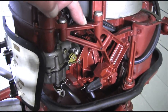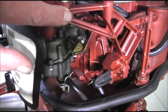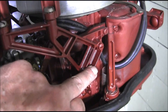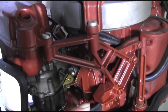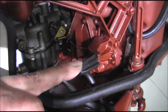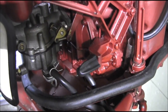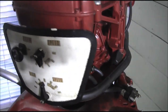Moving on to the other view — here is the front mount, and the front mount attaches to this bracket that my finger is on, which bolts through the air silencer here and back at the throttle advance. That bracket is available separately from your parts aftermarket — Sierra, whoever you're buying parts from. This rubber grommet isolator is also available.